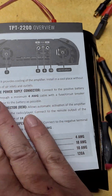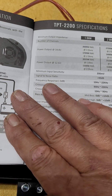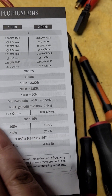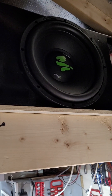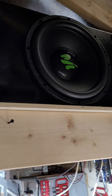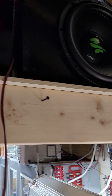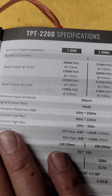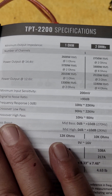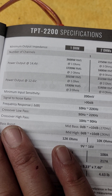The 1500 and 2200 power connection is 4 gauge. We're going to be running this into the Iron Man box, the Machete 12 Lite R, and my overhead shelving that rattles when the bass hits — it's not the sub. At 4 ohms, specs say 1140 watts at 12.6 volts.